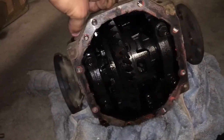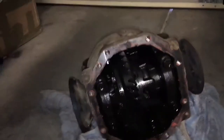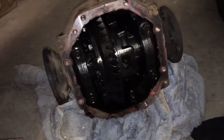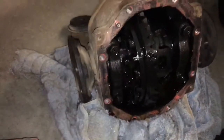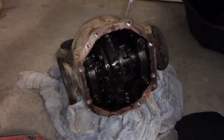That's a pretty important thing to realize — if you wanted to chase an aftermarket LSD and you've already got a Torsen, you need to get an open center first. So yeah, that's the diff story.